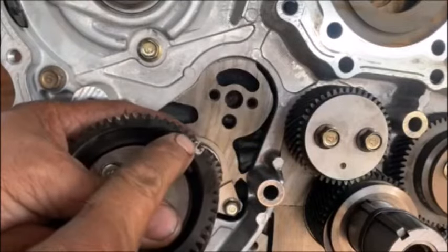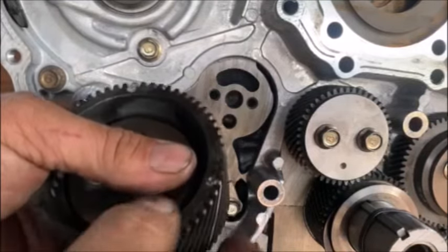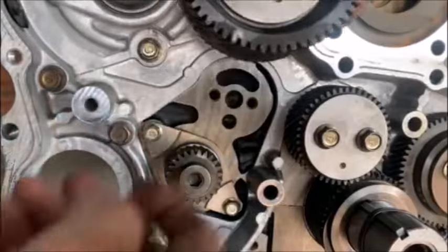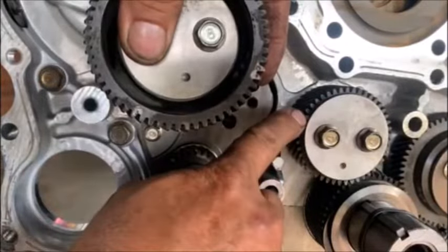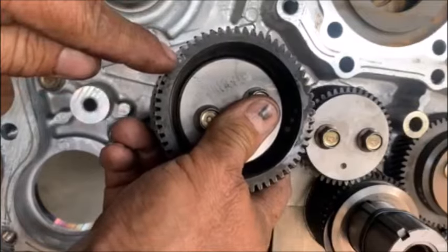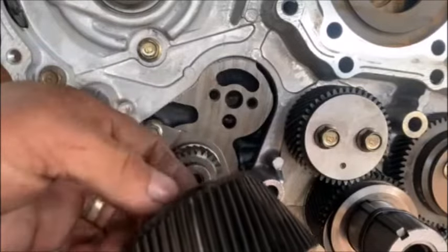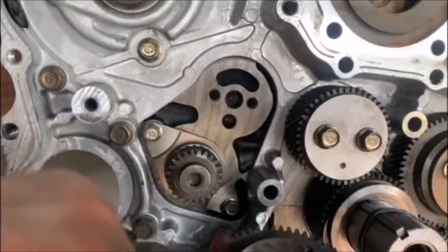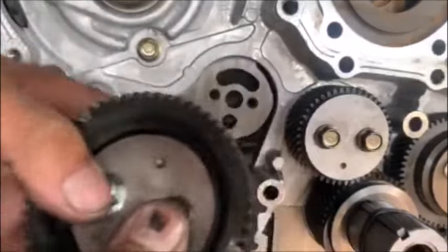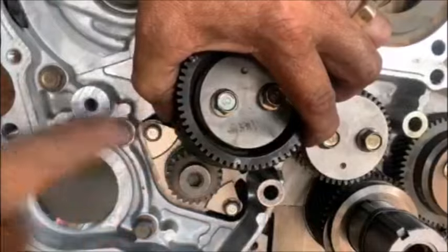This idler gear has got two markings over there, so you know that's going to be a single tooth in between it there; it's got a single mark over there, and a single mark over there. So it can only go in that way. There's two there for that one over there, there's one there for those two over there, and then with any luck this one will have two marks on it and that's where that one will go. First thing: make sure your oil hole is in the right position — there's the oil hole at the bottom. Also look at the machine markings, you know it goes that way around, and then those teeth have to be lined up. I'm not going to bore you on camera with that, I'll do that quickly and show you when I'm done.